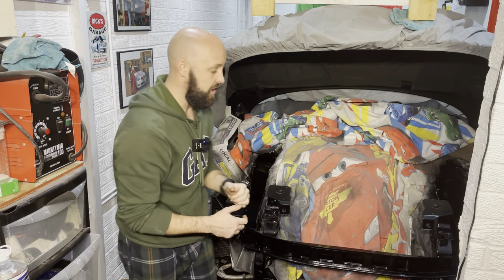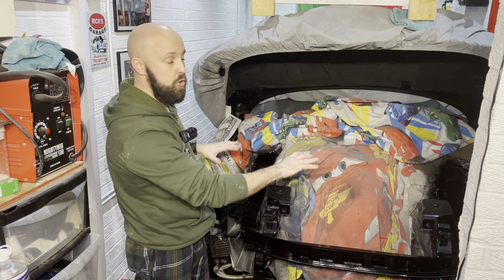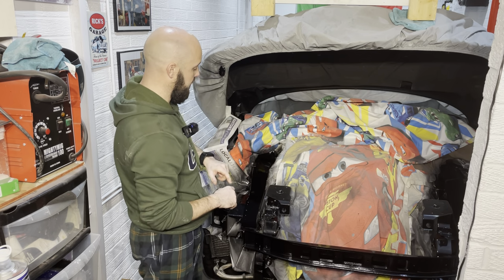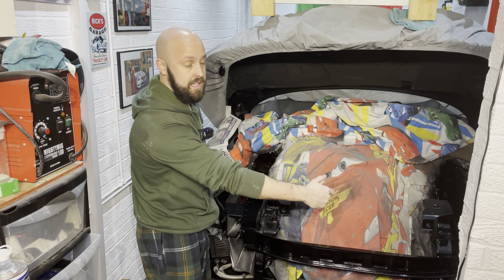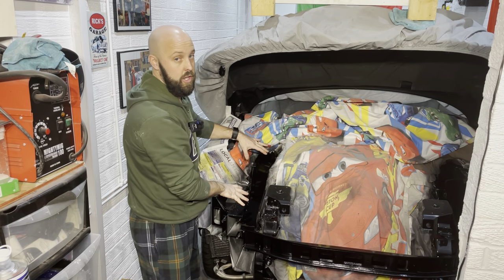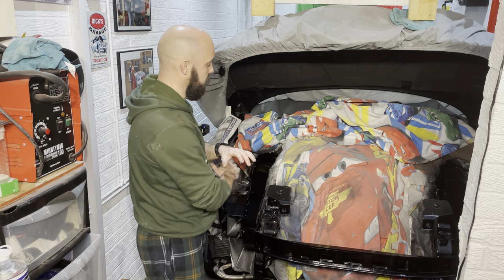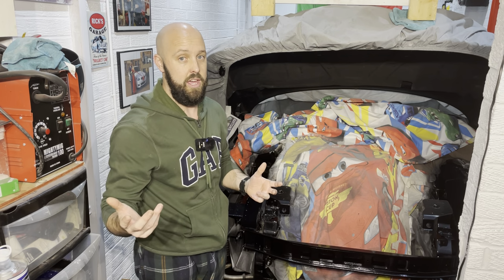Now, just a couple of last little tips when it comes to lacquering, guys. Try not to do the large surface areas that you can see first, because what may happen is you'll get a nice glossy finish on it, but then whilst you're doing all the little tight spots and intricate areas, the overspray from the lacquer may then settle on your nice glossy bits. So yeah, do the tight spots first, then do all the large areas second or last. Another little tip.